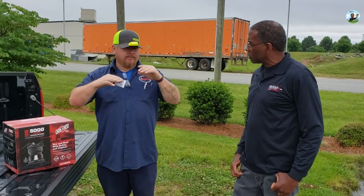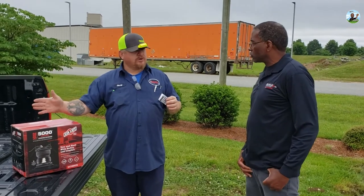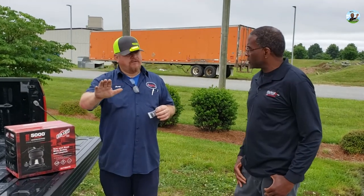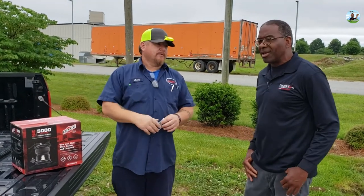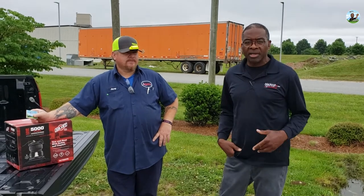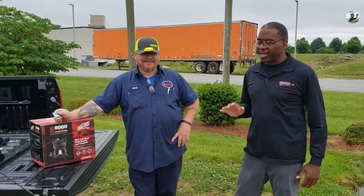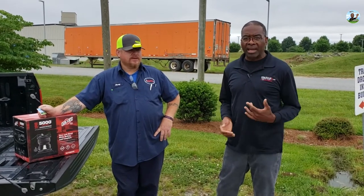That's why you're trying to get your truck level. Rule of thumb is: every inch your truck squats from the way it sits right now with the trailer, you lose 10 feet of stopping distance. So if your truck is squatting four inches with your trailer on it, it's going to take you 40 more feet to stop. That's why I bring all my trailer and equipment to Colfax and let Jimmy do the work — there are so many kits you can do yourself, but I'd rather take it to the experts, because with an expert you get the advice, and I know I can always bring it back.